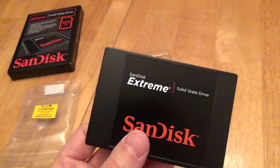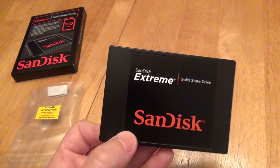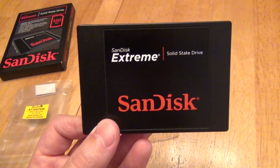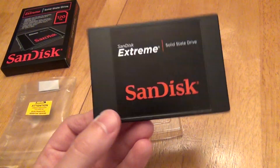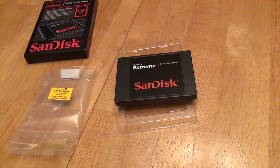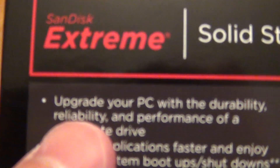What I decided to do is go buy the same thing that Crucial would give you — it's from the brand Apricorn, a product called EZ Upgrade. Basically, they give you a SATA to USB connector cable that you plug into the back of the drive, then plug the USB cable into your computer, pop the disk in, and it will do all the smart things to help you migrate from a larger hard disk drive — like my 500 gig drive — to a smaller solid state drive like this 120 gigabyte. I've spent a long time trying to get the migration to work, so I'm going to spend the 20 bucks and just get the migration cable and software they honestly should have given you in the first place if they're going to claim 'upgrade your PC.'